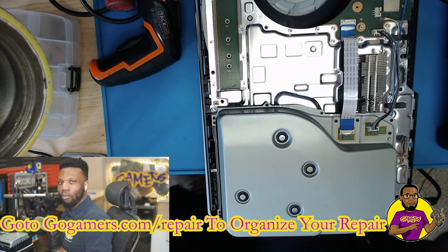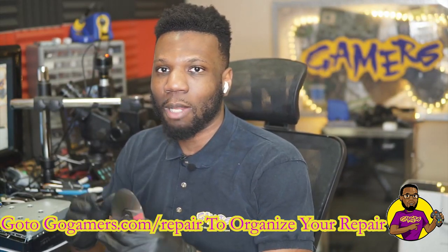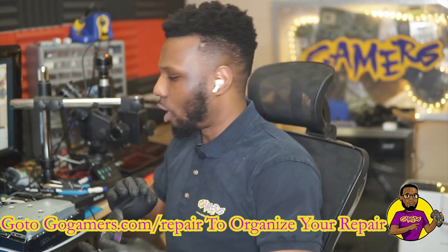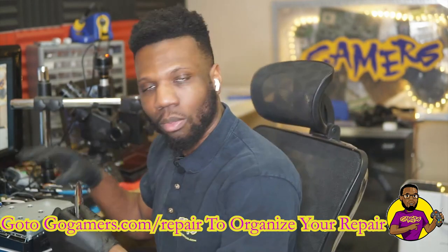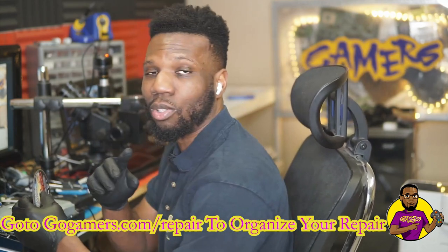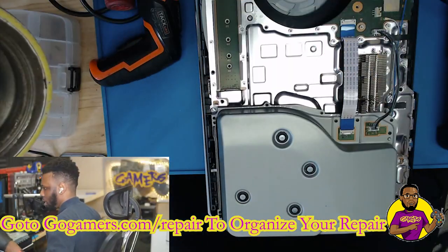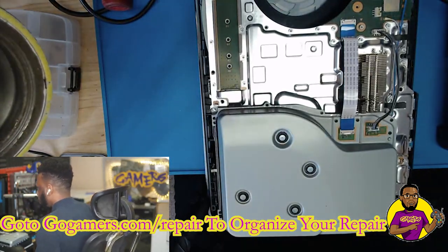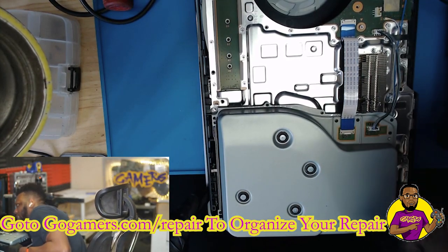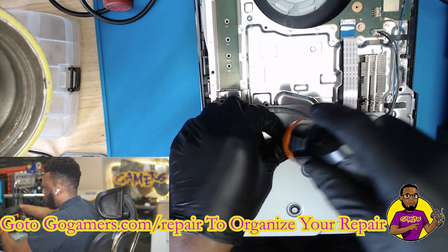So we'll be going over both of those issues — dealing with the rollers and dealing with the laser at the same time. I'm going to kill two birds with one stone in this video: show you guys how to properly repair these rollers and then show you how to get this game console to be able to read your game. So let's go back over to the upper cam. I'm going to shut this thing off because I don't have a fan attached and I don't want any overheating issues.